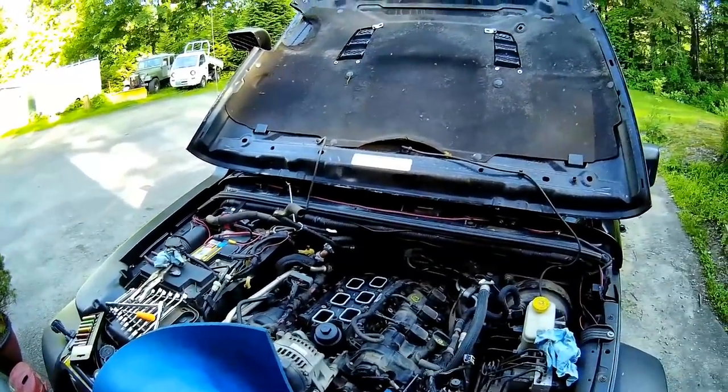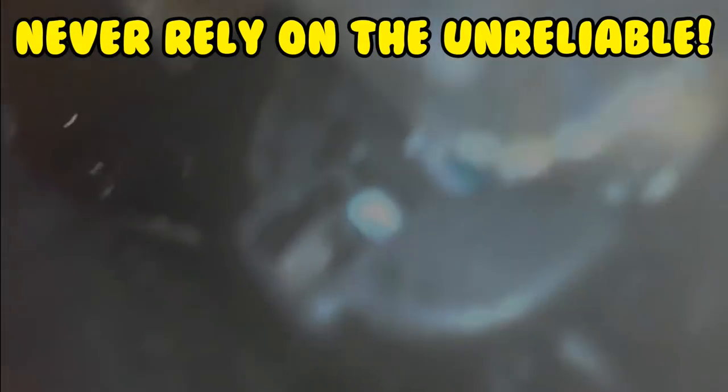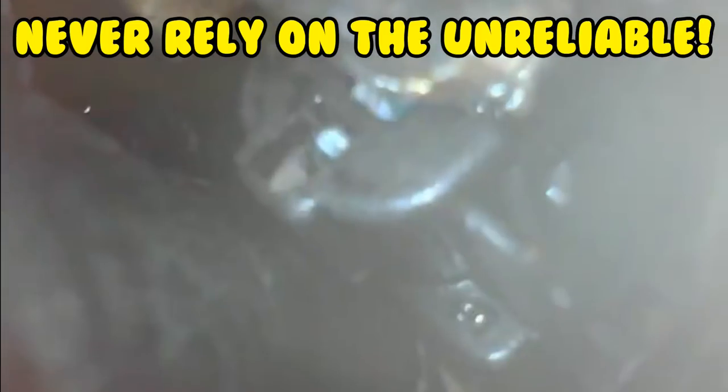I'm waiting for somebody to bring me coil packs from five hours ago. Had to run out to the auto parts store, go back into town and get the parts that someone was supposed to bring me. Now it's dark. Wasn't that hard of a job. So this video is for anybody else that has an oil leak or antifreeze running down their bell housing underneath — chances are it's the oil cooler.